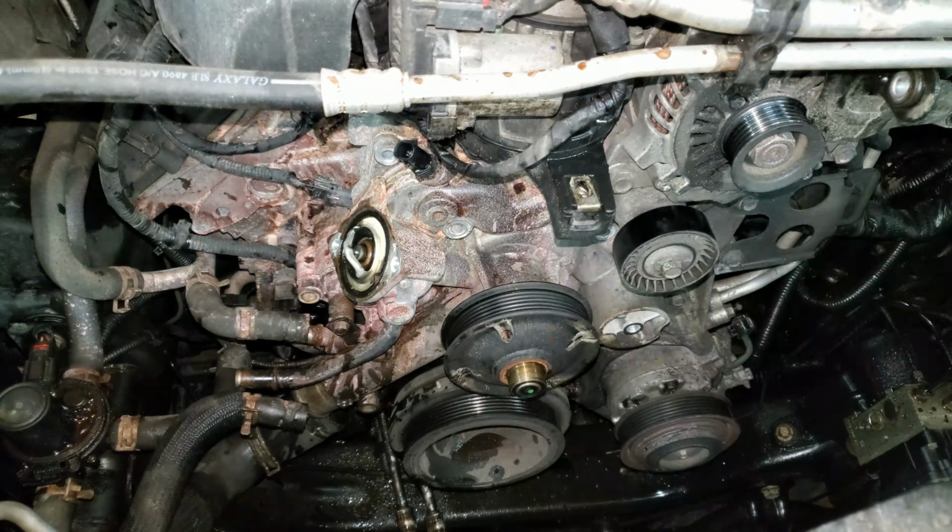I'm gonna take off this temperature sender. Hopefully it doesn't break. It's all plastic. This is a 19mm or a 3/4 inch for all you standard guys. I'm gonna replace that thermostat, so I'm leaving it in there. I bought a nice fresh can of PTFE. That's what you want for this stuff. It's pretty cheap at the hardware store compared to going to the parts store and asking for PTFE. A lot of times they look at you funny. This is tapered pipe, so the tighter you get it, the more it crushes up against the threads. Then I have a gasket to deal with here.